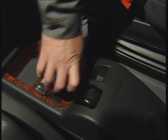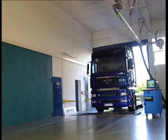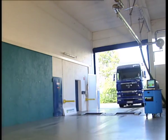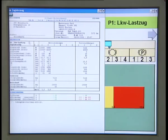If a parking brake or an emergency brake acts on any of these axles, the relevant results can also be assessed and stored. The MB8100 provides up to 17 different axle tests. In order to carry out an extrapolation, the reference pressure and the total gross weight will have to be entered into the input dialog for the vehicle and customer data. As a final step, the measuring protocol can be printed out via the PC station on any network printer or with a matrix printer of the MB8100 itself.